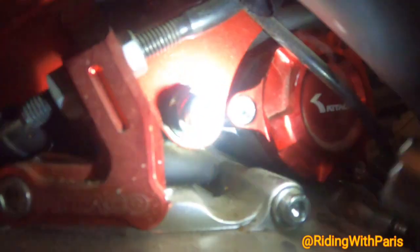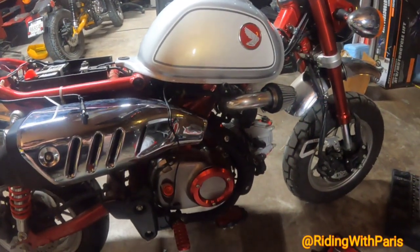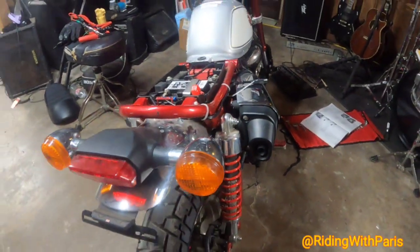You can see right here this little thing, and if you notice, the previous owner put a starter motor cover — some kind of bling from Kitaco — on it. We got to looking and up in this crevice there was the culprit: the ground cable that goes to the starter motor was not even hooked up at all. I don't even know how he had it running for it to quit running in the first place.